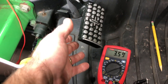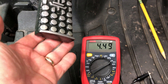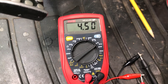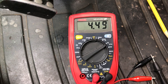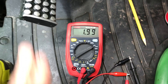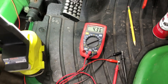Now if I pull up on the clutch, watch — it just jumped back to 4.5 volts. This is when people report: 'I pulled up on the clutch pedal with my foot and it went again and worked fine.' That's because the potentiometer is now within range — full voltage to the solenoids on the transmission, telling them to open fully forward, and that's why you're able to go. You don't even notice it, and then next time you put the clutch in it could happen all over again.